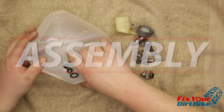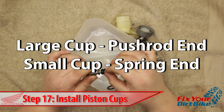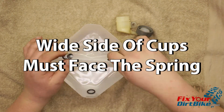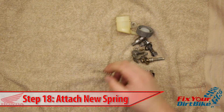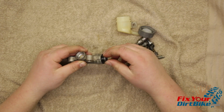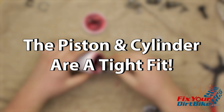Start your assembly with the piston. Make sure to use brake fluid throughout the install to lubricate your parts. Install the large piston cup on the pushrod end and the small cup on the spring end. Make sure to install the cups so the wide side is facing the spring end. Attach the new spring. Install the piston past the first cup and stop when the spring touches the end of the cylinder. The piston and cylinder are a very tight fit, so take care not to roll the piston cups